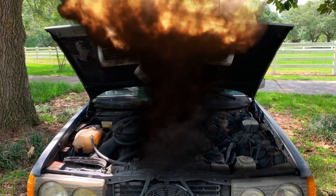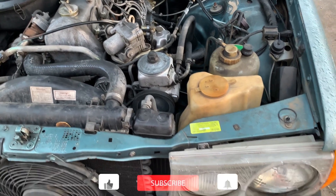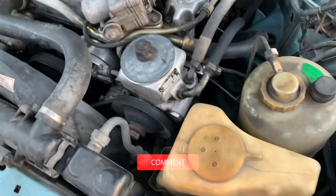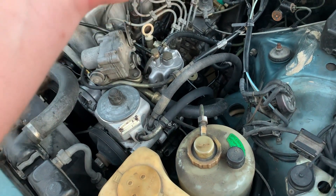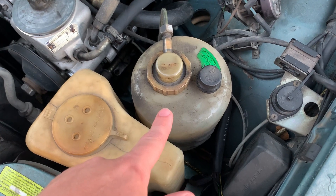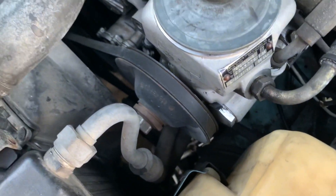Up at the front of the car you're going to have the tank and the pump. The pump runs off the engine, pulls fluid from the tank, pressurizes it, and sends it to the back — that's the basic function. Return fluid comes back from the pump and goes back into the tank. The tank has a feed from the pump via a hose you can see down there.